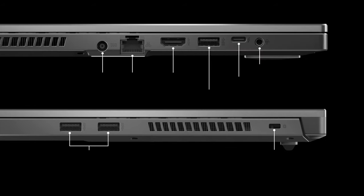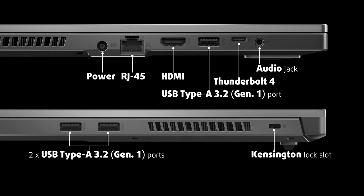Right now, there is one big advantage of Intel over AMD: the support of Thunderbolt 4 connection. In fact, the device can be charged via this connector with the optional 100W USB Type-C charger. Besides this port, you get three USB Type-A 3.2 Gen 1 ports, an HDMI 2.0b connector, an RJ45, an audio jack, and a barrel-style power plug.